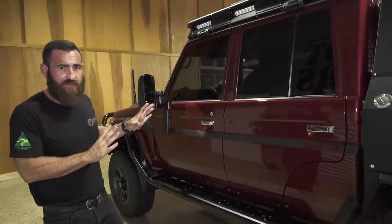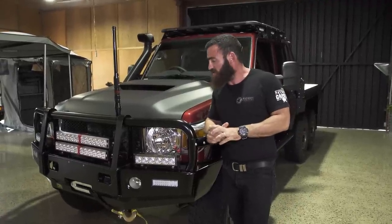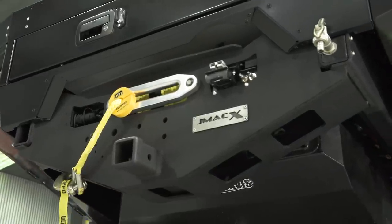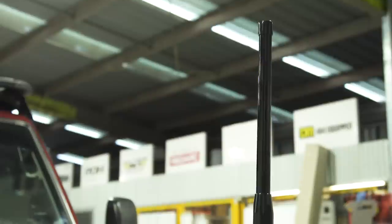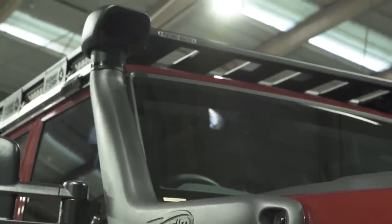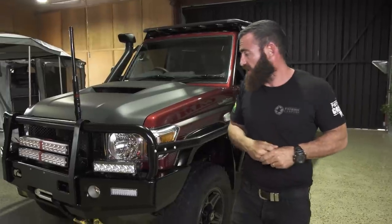Let's go up the front and run through the standard stuff that comes on the Super Tourer six-wheel drive. T13 TJM bull bar on the front — standard on all Super Tourer builds on the 200s, the 79s, and the Rangers — with 63mm top hoops. There's a 12,000 pound torque winch in the front from TJM and a matching one in the rear, though 12,000 pound might be a little light on this truck given the GCM — if you were towing your maximum four-and-a-half tonne you'd want something bigger like a 16,500 pound Warn. Also fog lights, GME whip at the front, Airtek snorkel, TJM sidebars, TJM side steps with the Patriot Campers platform — dimpled and logo'd. All Super Tourer Land Cruisers come with towing mirrors — you can pop them out, fold them in, and fold them out of the way.